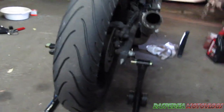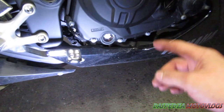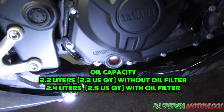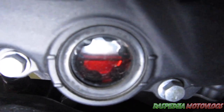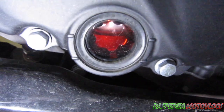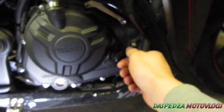Turn it off, then drop it down off any stands. Recheck the engine oil — I started with two litres to start it. After you start it and run it, pull the bike over level so it's standing upright, check it, and you'll need to top it up a little bit. You'll see two marks — a notch at the bottom and a notch at the top. You want the oil right on the top notch, in between the two marks. That's good operating temperature. Bring the bike level and make sure it's on the mark. Ensure the filler cap is tight.